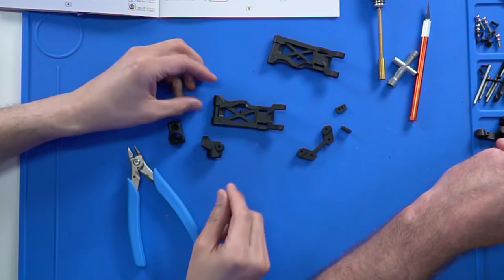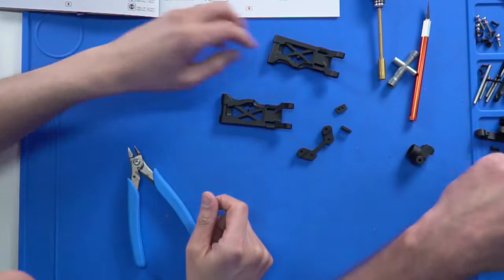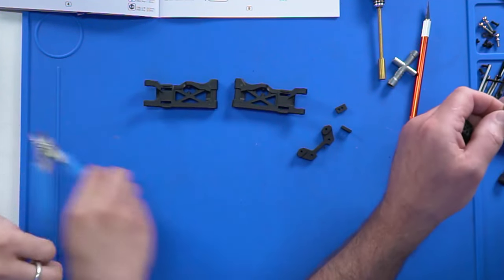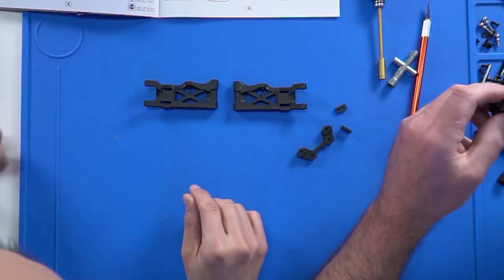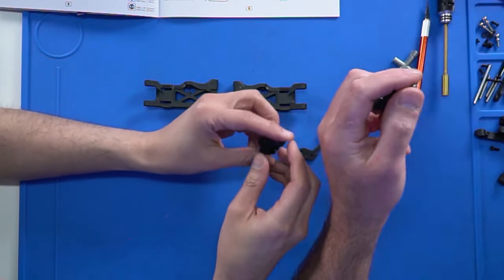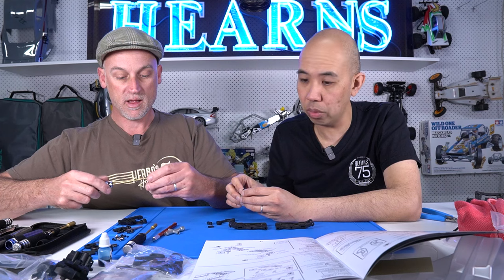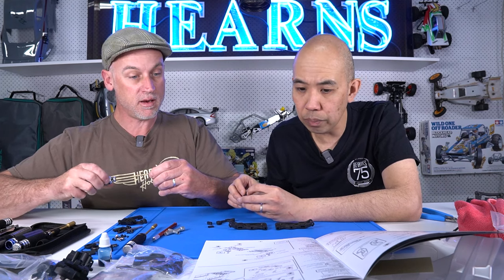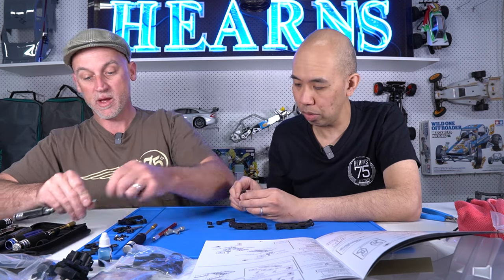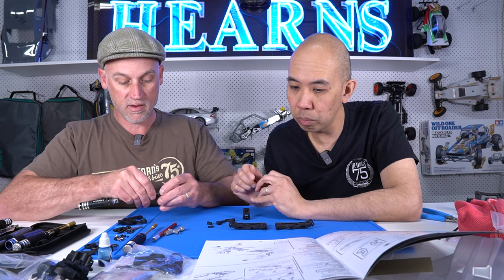Let's go. All right, so where do we go? Okay, so they're marked right and left, and we'll do this so we know what we're going on about. We've got the short one. So those hubs, are they the same, left and right? These are hubby hubs. So they are the same left and right? Yeah. Is it a mil and a half spacer under there? It is a 1 mil. A 1 mil spacer with an 8 mil ball stud, so a long ball stud. Classic Brett, just going at it, hell for leather.